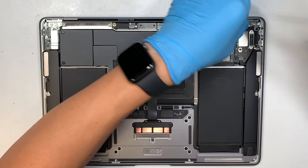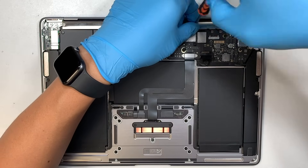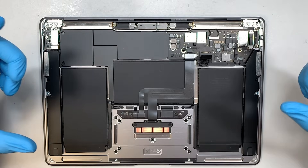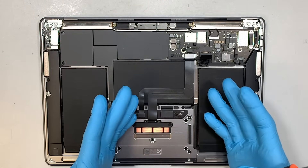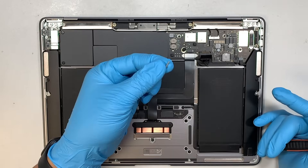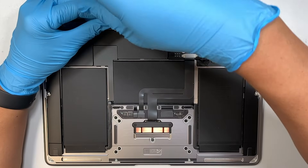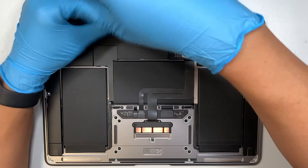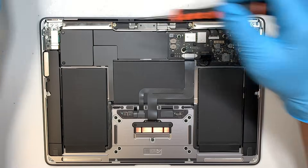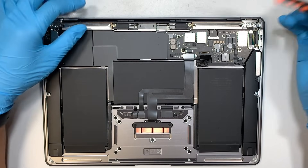Alright, T4 — we are removing the screws. I'd suggest taking a picture of your computer, printing it out on paper, and as you remove each screw, placing it on top of the corresponding spot on the paper so you know which screw belongs to which component when you put it back together. Apple uses a lot of different screws, so you can get confused when reassembling.